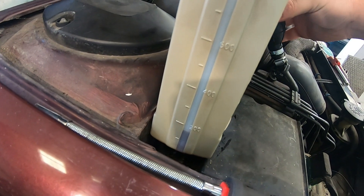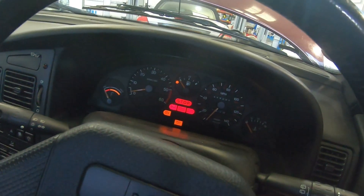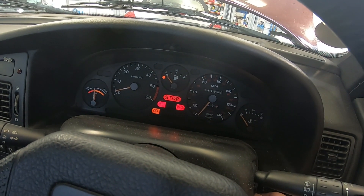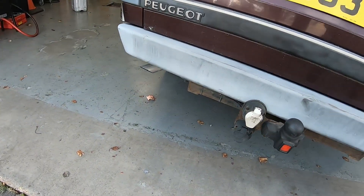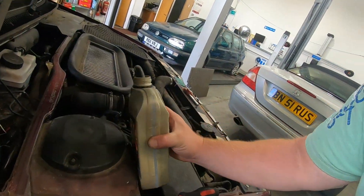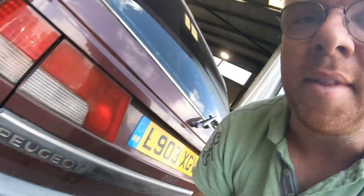The priming bulb's hard now — you can see it's going through. That's probably pretty much all in the fuel bowl now. So if we start her up, fingers crossed, wait for the glow plugs... she's running. I don't know if we're still running on diesel; we've got no smoke at the moment. It still smells like diesel, so we're probably still running on diesel. That bottle is now empty, so I'm pretty sure we're now running on a mix of engine oil and petrol.